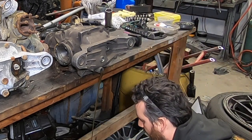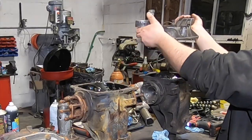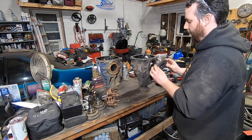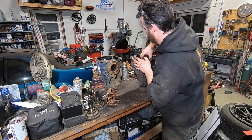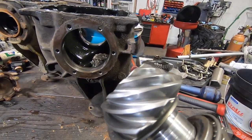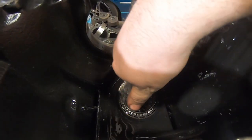She's got some confetti in this one. Now if you were just servicing a diff, you'd have to be careful that you're getting your shims back in the right place and all that. I'm starting from scratch so it doesn't matter to me - I'm just going to tear this one apart. You can see these small defects here on the teeth; this is what was causing some problems with this differential.